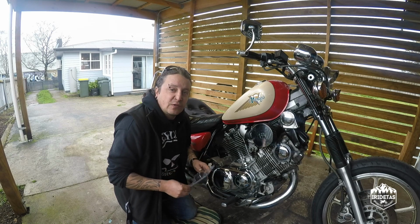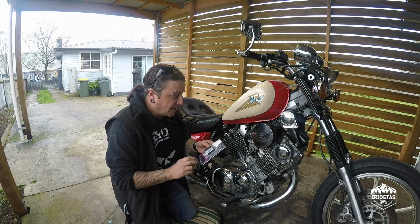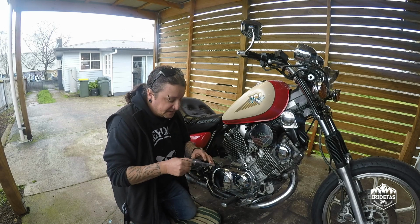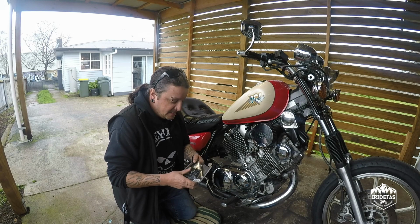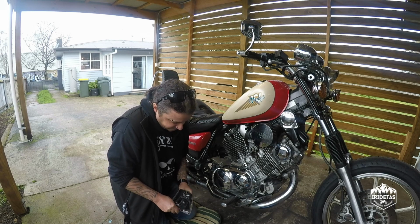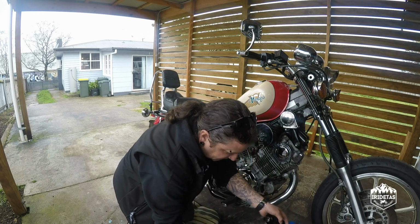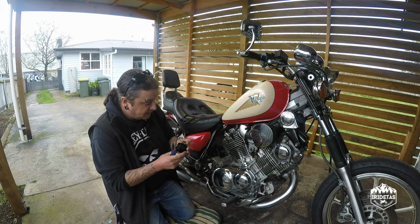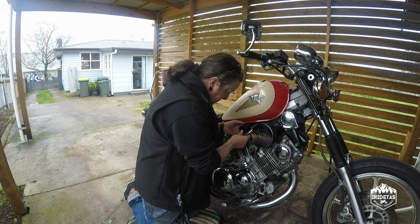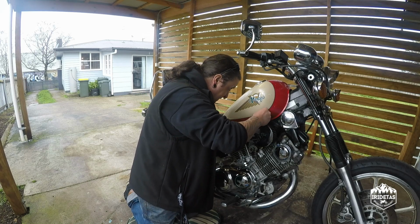So guys, I went for another drive to Autobarn, got myself a 12mm mini breather or crankcase breather from TCI Racing. This was $14.99, same as the other ones. So it's got a slightly smaller diameter because this is a smaller diameter pipe. Just a blade screwdriver. Yeah, fits on perfectly. So 12mm for the right hand side, 18mm for the left hand side.